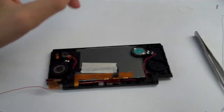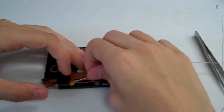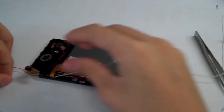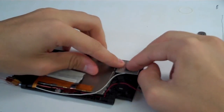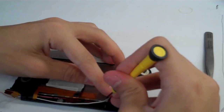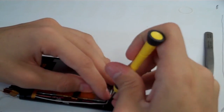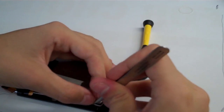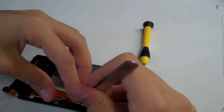Okay. We'll grab our antenna and do the same thing with the antenna. Antenna just goes through the hinge there on the inside. So you have those ribbon cables all rolled up in there, and the wires are going to pass right through the middle of the roll. So pull that through there, and then we are going to put our antenna there, and make sure your antenna wires are in these little cable management tracks. Make sure we get it out of the way of the camera.